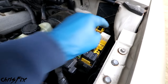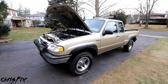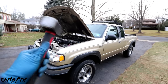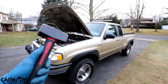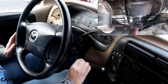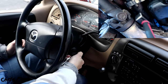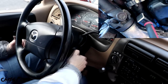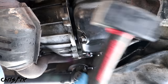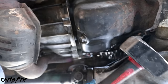After checking the fuse and the relay and determining that they're good, we've checked many of the common problems that would cause a vehicle not to turn over. So I'm pretty confident that it's the starter that's bad. And there's one more thing - kind of old school - and that's hitting the starter with a hammer to try to get the car started. Have somebody trying to start the vehicle as you're underneath hitting the starter with a hammer. So there you go - it's a good little trick that'll get you home, and now we also know the starter is definitely bad.